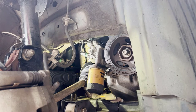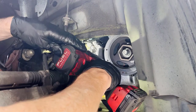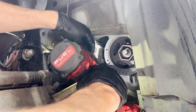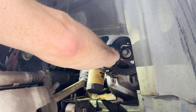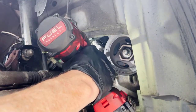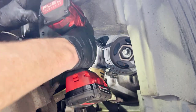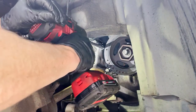The first thing we need to do is drain the oil out of the car, because we are essentially going to take off the oil filter housing itself — not the filter. In this video I'm not actually going to remove the filter because I didn't have a new filter to put on, and I'm due for an oil change in a month anyway. So I'm backing out these three 12 millimeter bolts. These bolts are not the same size — two of them are the same size, one of them is not. I've got several notations to help you keep track of that.